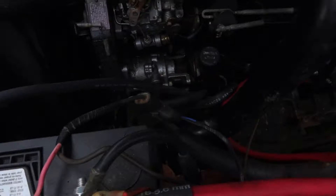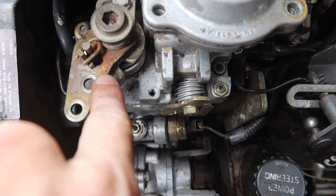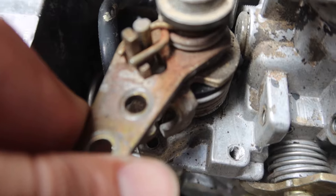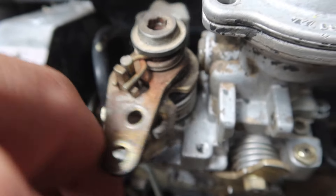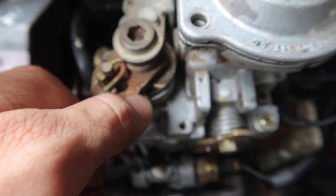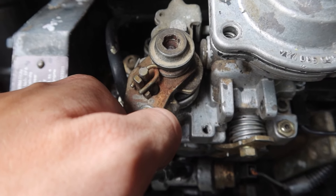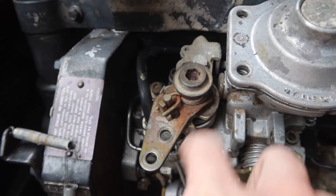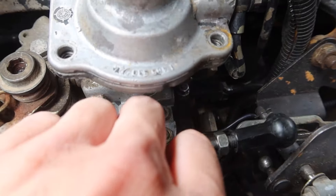I've been adjusting and tightening up the linkages. You can see on this rod there's basically a big groove in it as well as the side of the spring — it's extremely loose. Looking at the indexing after I took the nut off, it's indexed incorrectly — it's limiting the throttle linkage travel on the insides. I'll give that more attention when I swap governor springs. As for this, we took the inside ball off and we're going to put our linkage on the inside because that utilizes the most travel the bell crank has.